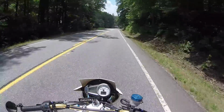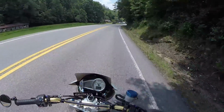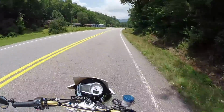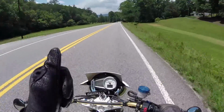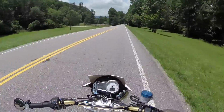So think about it this way: if you go out to your car tire and push in with your thumb, if it's inflated real high, it's going to barely give in. So not much of your thumb is going to be touching the tire because it's so hard. But if it's flat and you push it in, then your thumb will depress deep into the tire and a lot of the tire will be touching your thumb. That provides more friction, more available traction.